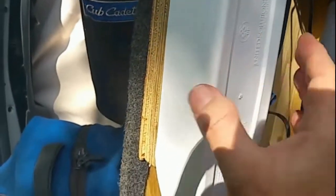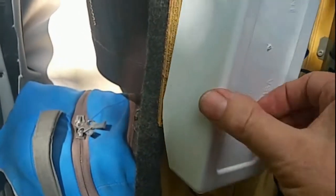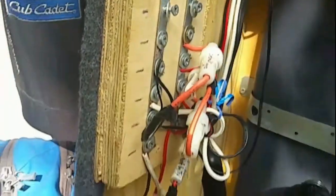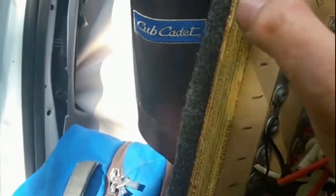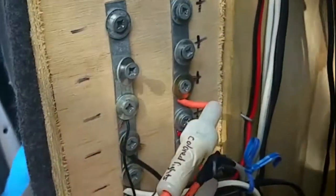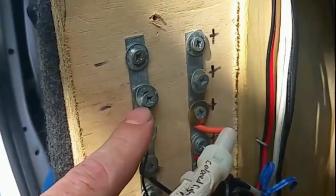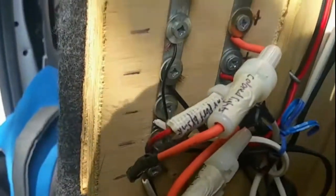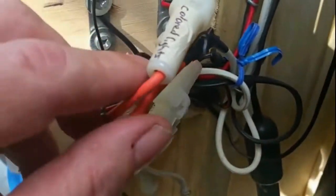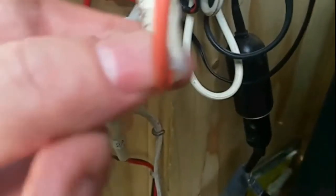To address some concerns: you can see I have a protective plastic covering over all my connections here — I normally have it screwed down more than just finger tight, but I loosened it for the video. I took a piece of wood, screwed it up, and cut two strips of metal — one marked negative, one marked positive — with screws and washers to make easy connections. I have everything wired positive to negative with inline fuses. You can see I've marked each one: 12-volt port by the TV, the sink lights.